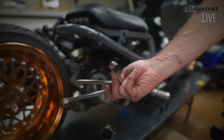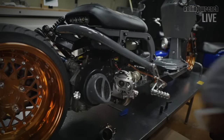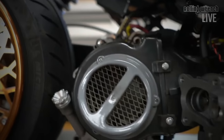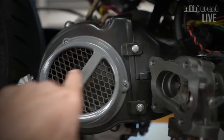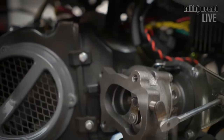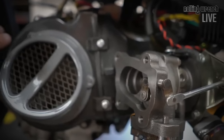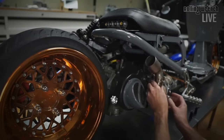What does the gray scoop do? That's a cold air scoop. On a GY6, this is how the engine gets its cooling — air goes in here, there's a fan in there, it sucks the air in, air goes around the engine, and gets spit out the other side. It doesn't really help that I have the exhaust going right in front of that. The exhaust is going to go just like that.